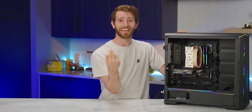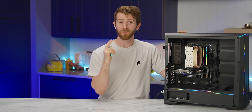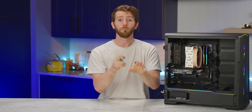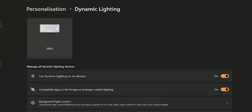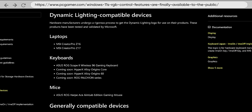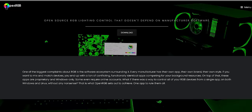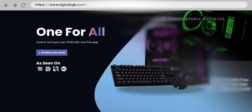Speaking of things you may or may not like — RGB. The one thing we can all agree on, love it or hate it, is that the control software is a CPU hog. For best performance, I'd recommend leaving the RGB alone on rainbow or off. But if you must adjust it, there are alternatives to the many vendor-specific RGB control apps — Windows 11 even recently got control for this, albeit with limited compatibility. To consolidate your RGB into a single app, try OpenRGB or SignalRGB. OpenRGB tends to be lighter but less flashy, while SignalRGB is more capable but will make your CPU work for it like the others do.